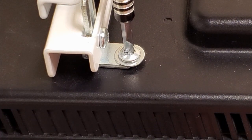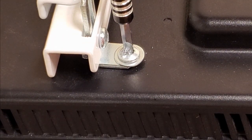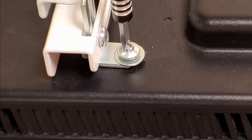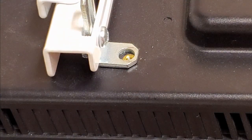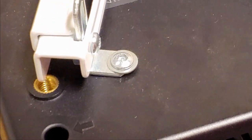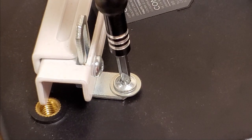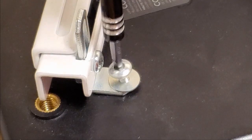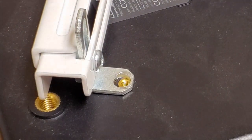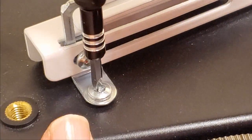And there's two ways you can do it. You can actually bend it and break the pin off and then just use a normal hex driver to get it out, or you just jam it in there like that and it just takes the screw out. If anything, it's a little easier than a standard security driver. I'll show you on this one I have not loosened, so you can see it just goes down in there, and then I just give it a little twist, and then there we go. And this works on the Torx type as well as just the normal, you know, Allen key hex type.